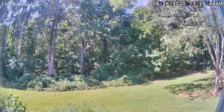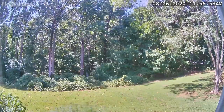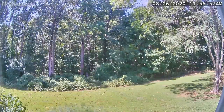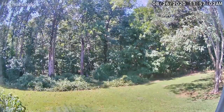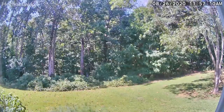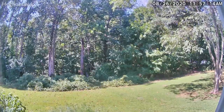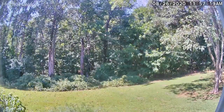Let's take a look at some image samples. Here's the first shot of my side yard during the day. The frame rate is pretty good — it's running at 30 frames per second. The resolution is 1080p, but you'll notice a lot of compression artifacts because it looks like it's recording at about the same bit rate it streams at, around 2 megabits per second or so. Not bad for cameras of this class, but it's not going to give you a nice crisp 4K image. The field of view is 150 degrees.